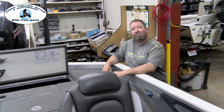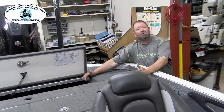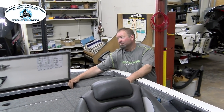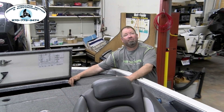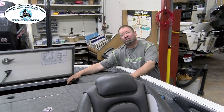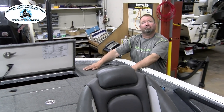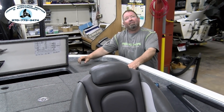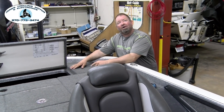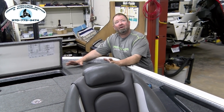The power goes out in Zavala literally weekly. There are a lot of boats that don't have that breaker switch. I suggest you get that. For a 12-volt trolling motor, you need a 30-amp disconnect breaker. For a 24-volt, you need a 50-amp breaker. And for a 36-volt, you need a 60-amp breaker. If your boat does not have an inline breaker that you can cut off before you charge, you need to have one in there. Simple fix to keep from blowing the board out. If that breaker's on, there's a chance it happens. If that breaker's off, there's a 100% chance your power board will never get popped if there's an electrical problem.